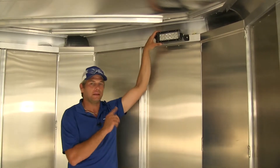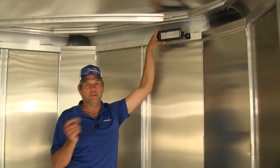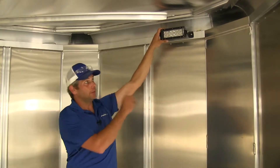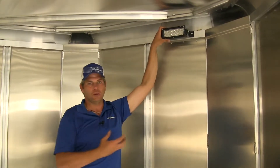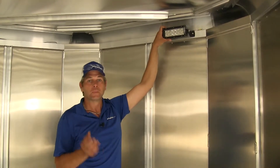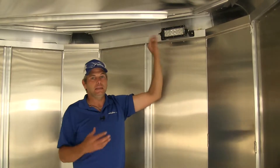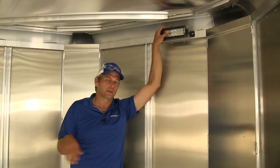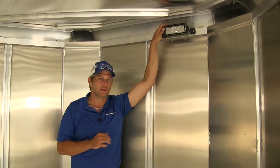Also, with the LED type lights, they have a much longer lifespan. We don't have to change out the bulbs all the time and they draw less power. These lights are all going to be run off of a 12 volt from the vehicle, so we don't want to overload that system and draw a bunch of unnecessary power through there. Also, being in this enclosed space, these generate less heat than what you get out of an incandescent bulb, so you don't have to worry about the heat buildup quite as bad.